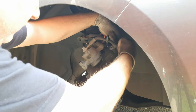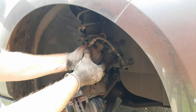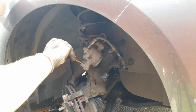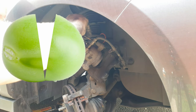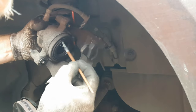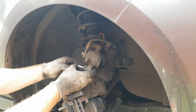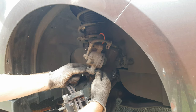Back at the caliper, you can remove the hose clamp now and make sure that your piston is pushed fully home. With your brush, put some Ceratec inside the slide pin rubbers — do that for both; about half a pea-sized blob is quite sufficient in each. With your brush, also dab some grease where the pad contacts the caliper and onto the piston face that contacts the pad. Put your slide pins back in, make sure that they run completely free, and rotate them to spread the grease around.